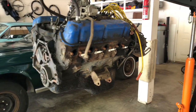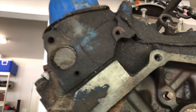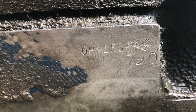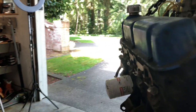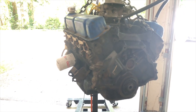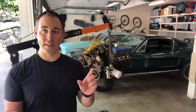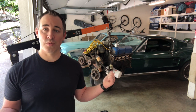In order to narrow down the specific assembly plant and get an idea of what car the engine might have originally came out of, we need to locate what's called the partial VIN. This is located near the top of the rear block on the passenger side. Again I used a lightweight wire brush and some degreaser and cleaned that area right up. The partial VIN reads 0P-155421 with a 790 just below it. The zero means 1970, the P means Twin Cities, Minnesota assembly plant, and the 155421 and 155790 are sequential serial numbers of the car it was installed into at the factory. Based on some internet research from folks at the Vintage Mustang Forum, during that time at that specific assembly plant Ford was producing Galaxies and LTDs — so chances are that's what this engine was originally put into. Pretty cool.